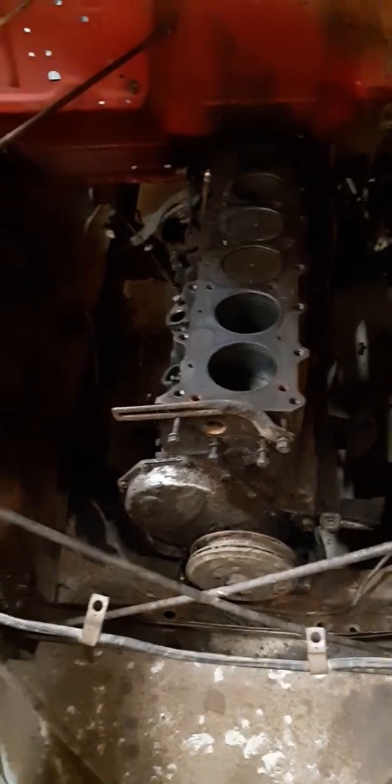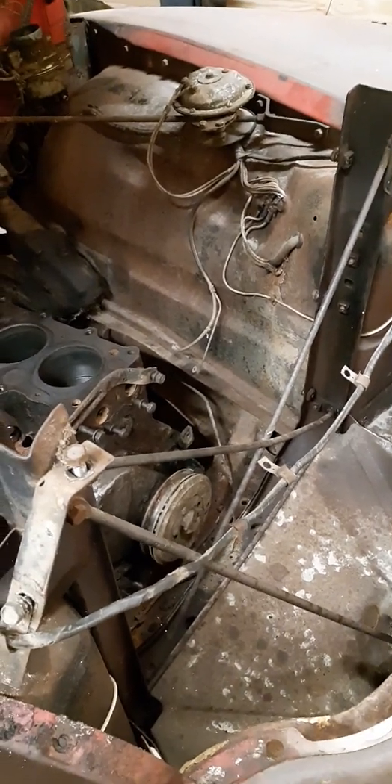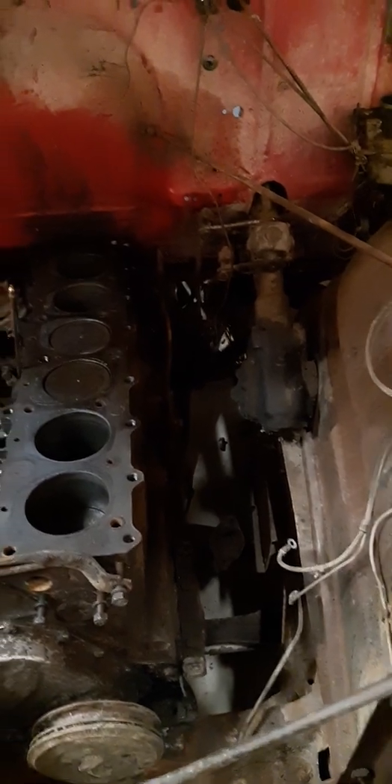So all the engine's junk — it's coming out. I've got all the engine mount bolts out; I only had to cut off the rear ones. The box is all stripped, starter's off. Looking for a 235 or 261 to put in it, which makes my life easier with the steering box being kind of in the way. Otherwise, there's going to be a 350 with a turbo 350 behind it and then some sort of rear end that'll fit into this truck, being that this is still a closed driveline.